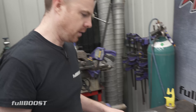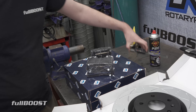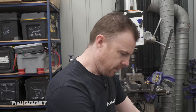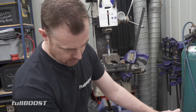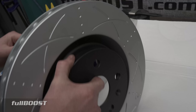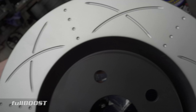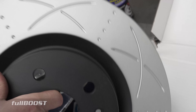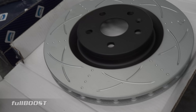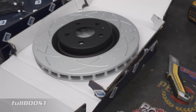They're not designed to keep on wearing to the point where you've probably seen memes on the internet where you can see the veins showing through. These ones have got the dimples on them - they're not drilled all the way through, so they're similar to what you would call slotted. I don't really like the cross-drilled ones - I've had them on cars before and I've had them crack. My Megane has them standard but they've just got a normal solid disc on them now. These look good - they'll help wipe off even more of the heat, not that we'll need it in the Commodore.